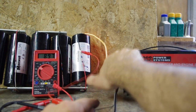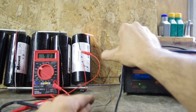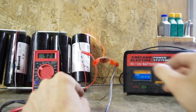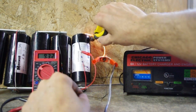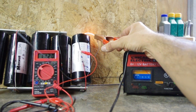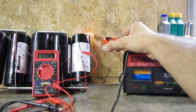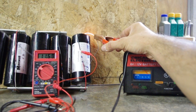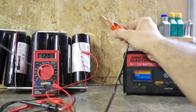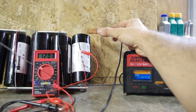I'm trying to keep it within the range of this charger. We can always give it a couple of bursts for a little bit — try not to let it touch the case or it will melt it. Once we get to about 12 volts I'm going to shut this off. I could probably handle 12.5 but I don't want to risk over-voltage — I hear that reduces the life of the capacitor quite substantially. All right, 12 volts — always expect to lose a little bit over time and immediately after you disconnect it.